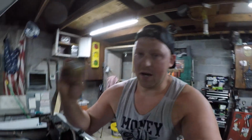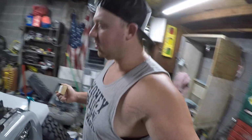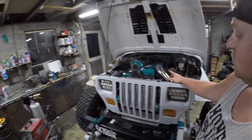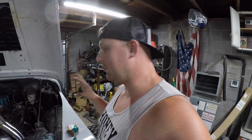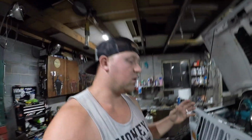So why you clicked on this video most likely is because I'm going to show you how to install governor springs on a P pump, or a P7100 pump. Now these come on the 12 valve Cummins, but you can do a P pump conversion on a 24 valve, and that's what I have in my Jeep, the 24 valve with the P pump conversion. The advantage of that is that it turns everything all mechanical. So I literally have a fuel shut off right here, and I don't have any computers or anything. So that works out really good.